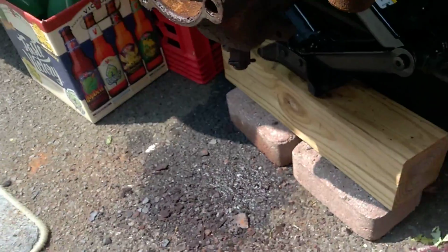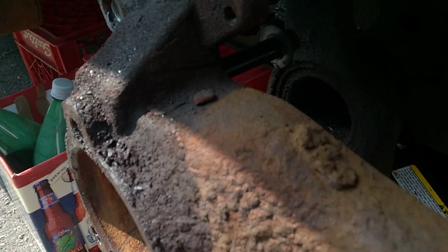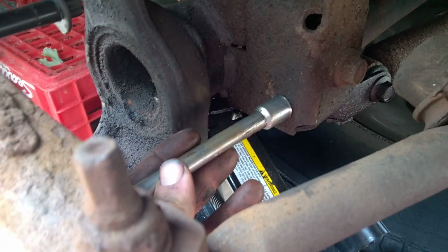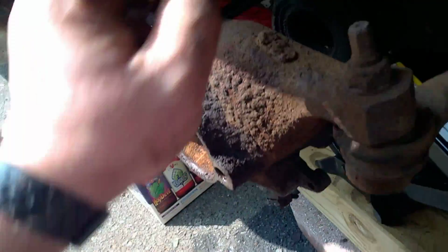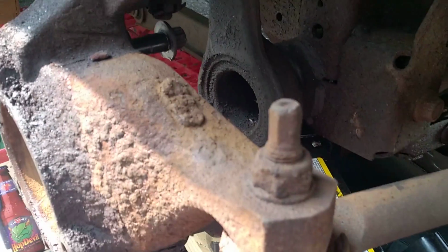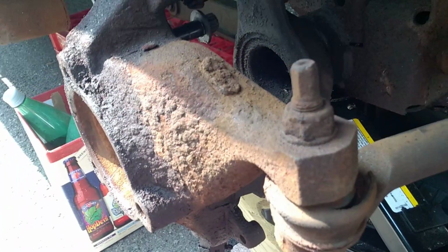And that worked. This top bolt was still in here. When you use the power steering against the frame with one of these, it twisted up my extension a little bit. But when you do that, you only want to back off this bolt just a little bit, probably 2 or 3 threads, maybe 4 threads, just enough, and do that very, very sparingly, because the power steering's got a lot of pressure on there.